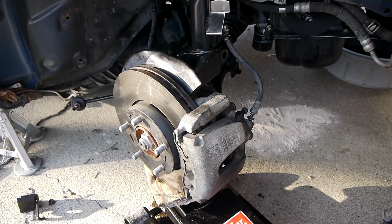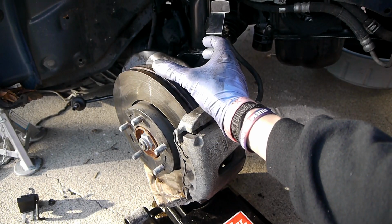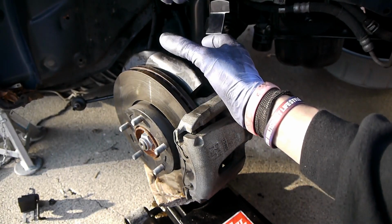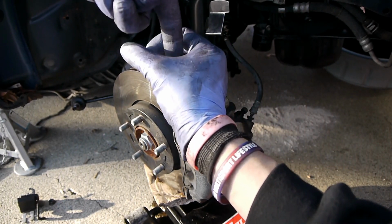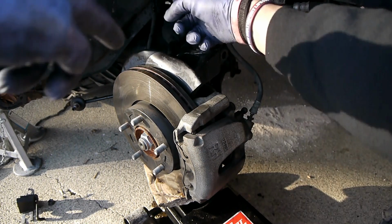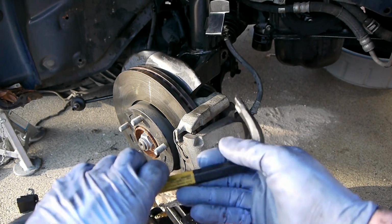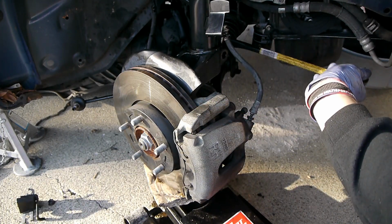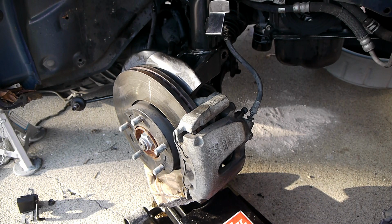So I've been pushing on it with a jack from underneath. What that actually does is it rotates this knuckle this way. So obviously, instead of going in perpendicular, this edge kind of digs into the strut. So what I had to do is I actually have a crowbar, and I had to just keep prying the opening there on the back while jacking it up, spraying it with a little lubricant.